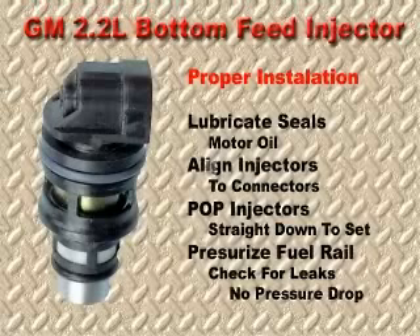If the fuel pressure drops and a leak is present, you must remove all of the spark plugs, disable the ignition, and crank the engine over to remove all excess fuel from the cylinders. It is not a difficult job — it simply requires adhering to a set of procedures to guarantee the integrity of the fuel delivery system.